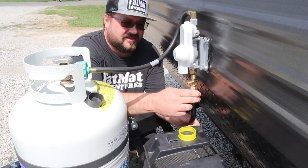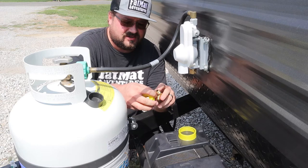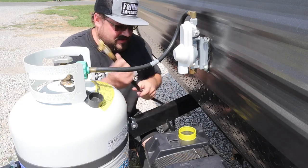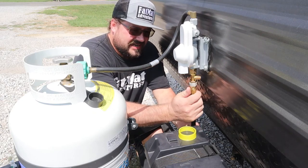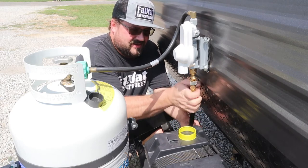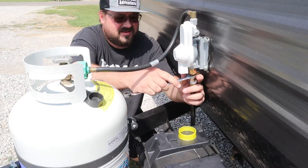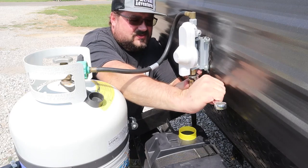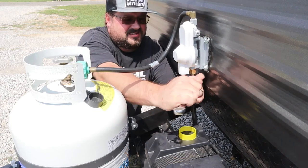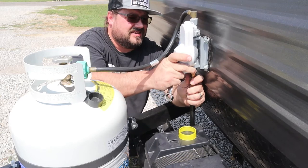Now we've got plenty of room to put this T connector in the bottom of the regulator. I'm going to put some more gas tape on these threads here on the T connector — just one layer, maybe one and a half. The bottom end of the hose down there so I can twist the hose, and I've got plenty of room here to screw this in without the T connector actually touching the trailer. I'll twist it in there, and once it's in there kind of snug I'll grab a wrench and tighten it up. I just want to twist this around so it's facing my direction so I can get ready for the quick connect. Now we're ready to go.